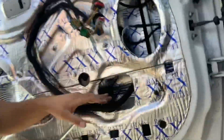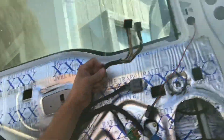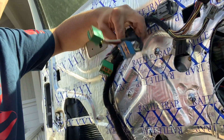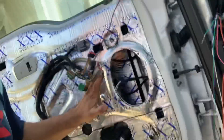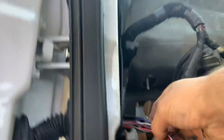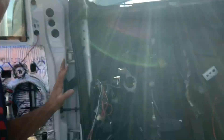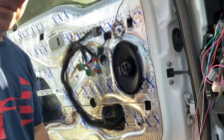We're deleting the old plug and old mirror — we don't need those anymore since we've already replaced them. Cut, splice, and make it look like the passenger side. The driver door wiring is now all done. We've got it coming up with a beautiful harness, mirror switch plugs ready to go, new mirror plug ready, window switch and lock ready. Wiring for this door is complete. I'll slap the new speaker in and then we can start running stuff inside the truck.